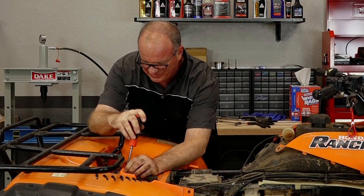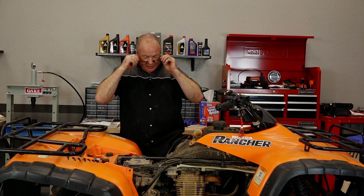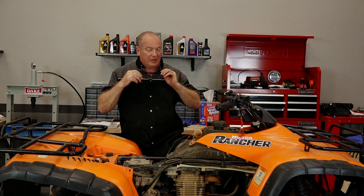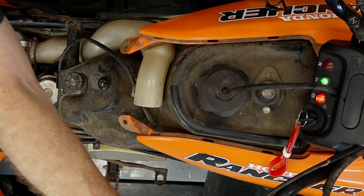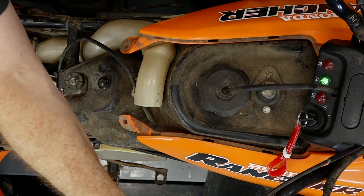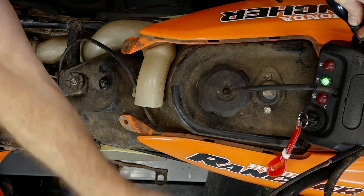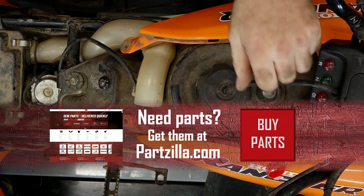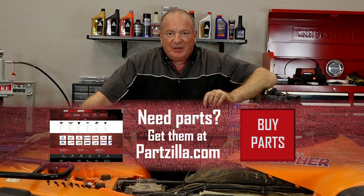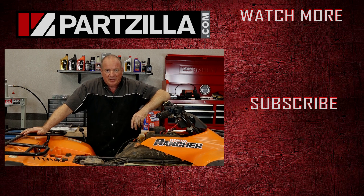Alright, last but not least, you need to hook up the battery — this should be the first thing you do and the last thing that you do. Now when you're going in to reset the clearance on these, you need to do it with the engine cold. But I can tell you this one definitely needed to be adjusted because it was ticking like crazy. Well, they're put back together — let's fire it off and see what she sounds like. Oh, much better. Well alright guys, that pretty much wraps this one up. This is a very important part of maintenance that you need to keep up with. If you do need any parts for your machine, come over and see us at partzilla.com. If you have any questions or comments, leave them in the section below and I'll do my best to answer them. Until next time, thanks for watching.